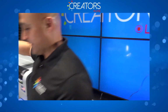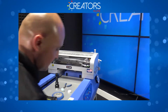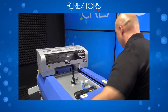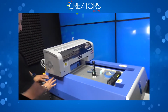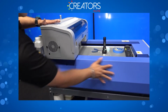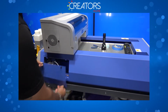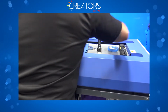which is on the other side of the printer. I'll go ahead and turn this around. So your encoder wheel is located on this side of the printer. As you know, the controls are on the other side. This side is completely flat. You're gonna have to remove this plate by pulling the pins, so we can expose the encoder wheel.